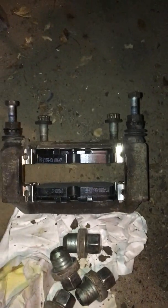Got the new pads in, so I'm going to switch out this old caliper, which is the housing cylinder. It's not pushing in anymore, so it's stuck or seizing inside this hydraulic compartment here. So I probably have to take out the screw and replace the whole housing cylinder with the new one, and just mount that caliper bracket back in since one of the pins got stuck.